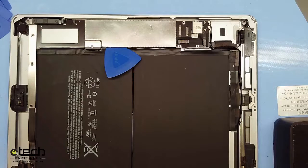The name is a little confusing and I'm working on possibly restructuring it. What the tool is basically meant for is if you ever have a stripped screw — it helps grind a new head into that screw so you can back it out with a different screwdriver. It's great for a stripped pentalobe on newer phones. It also has a secondary use of removing ICs using a grinding method versus desoldering. If you're interested, take a look at next week's stream. Hope everyone has a great weekend and we'll see everyone then.